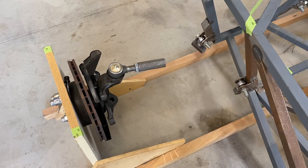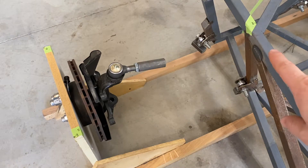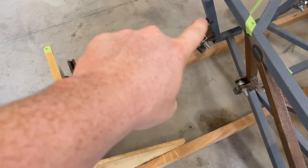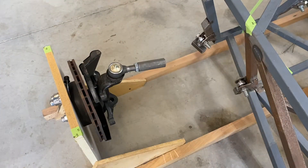The wheelbase is set so that the center of the hub is between the two frame mount points. This is an early 442 frame, and the control arm mounting points are set front-to-back per the Kinetic Vehicles plans, though you can move them. I added one inch to pull one mount out a bit — something I did six years ago when I wasn't sure what I was doing. I don't want to buy another lower control arm kit, and it won't make much difference. The control arm rotation axis visually points toward the differential, but I've measured it and it'll be fine for a street car.